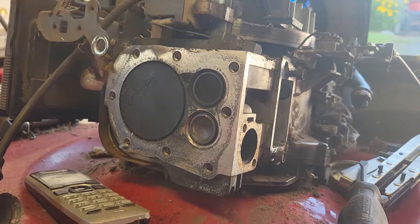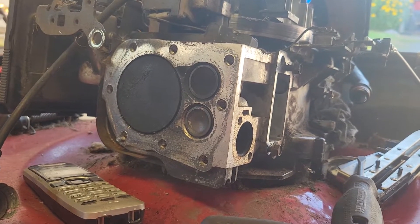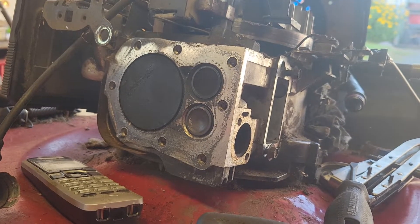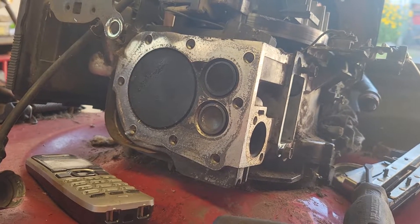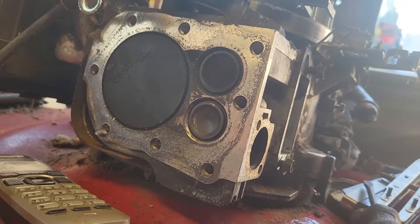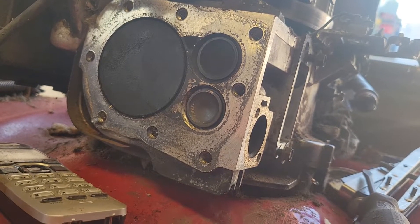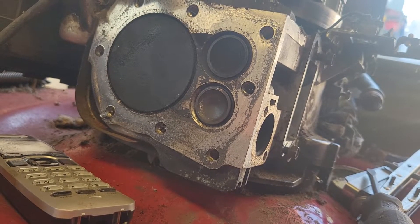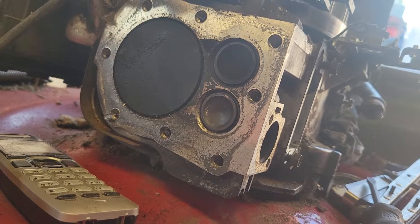This fella has a Quantum 128 m02 — he put an overhead valve spark plug in it, and the valve hit the spark plug, so of course it wouldn't start. I finally went to take a look at it. I got it to top dead center using a straw in the cylinder head, valves were closed based on the valve cover being off, and I had severe leak-down coming out the exhaust valve — obviously damaged from being hit.